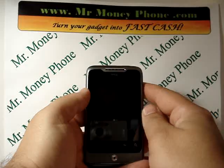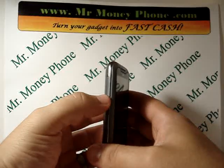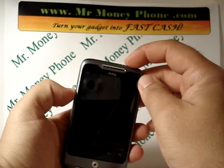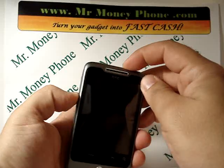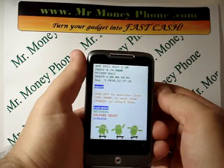This is one of the easiest phones to do a hard reset on when the phone is turned off. All you're going to do is hit the down volume button and the power button on the top. Just hold those for maybe about three to five seconds, and you'll see the reset menu pop up.